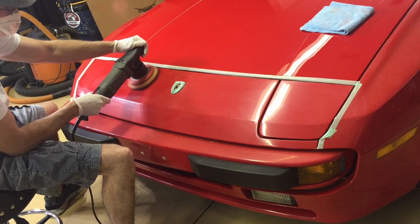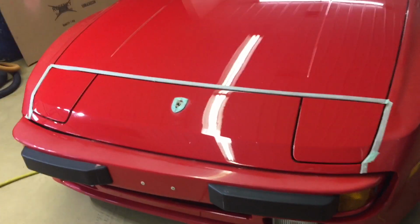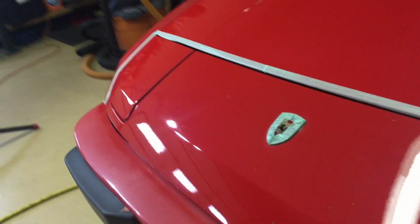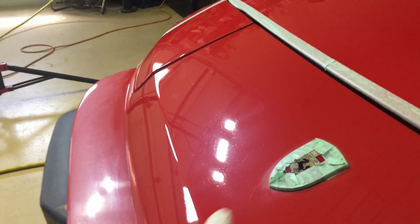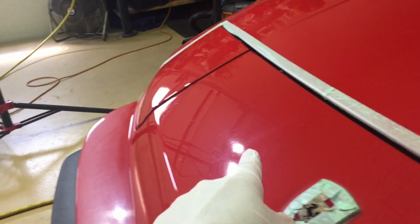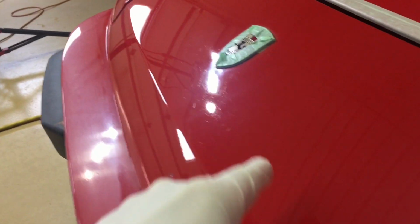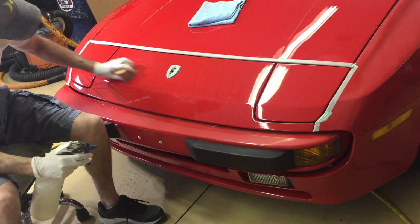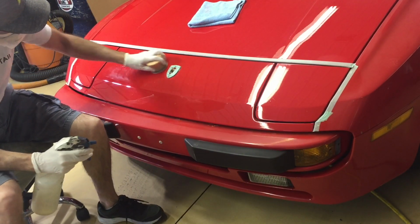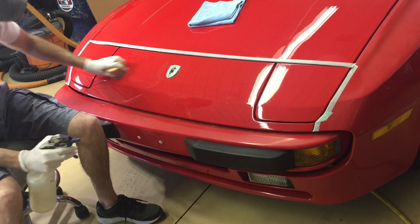So then you could do a little bit of light polishing. I know some of you guys just love to hang on the polishers all day long, and that would drive me nuts. I can't personally do that. It's not great for the surface. It's not good for clear coat. It's not good for paint. You're raising temperatures way up, exceeding 140, 150 degrees, where the rest of the panel is room temperature. It's a lot of stress on the surface. Learn to wet sand. Grab a panel, practice.